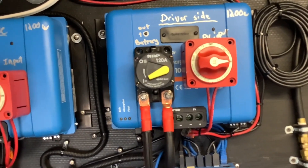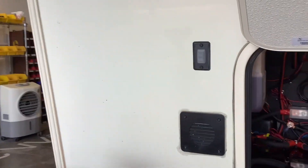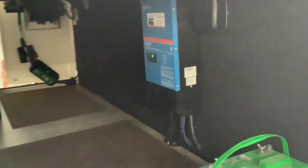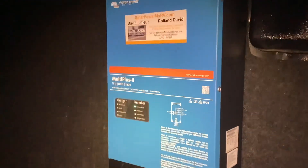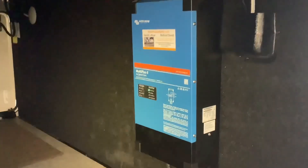With this amount of solar, it can recharge the whole battery bank from zero in one good sunny day. Moving on to the inverter, which we mounted on the other side of this wall for better airflow—we have a 3,000-watt inverter that powers everything in the RV, including both legs of 50 amps. This is a MultiPlus-2, so it'll power everything from the batteries in one unit. It also includes an automatic transfer switch, and it automatically turns into a large lithium battery charger so you can quickly recharge your batteries with shore power or with a generator.